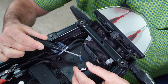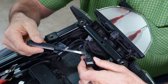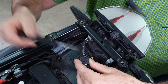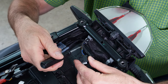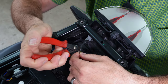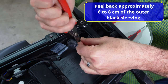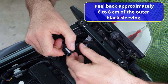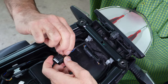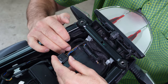Next, peel back the insulating sleeve on the socket that goes into the tail lamp assembly. Your sleeve may come further up to the edge of the socket. Carefully use a screwdriver to start unpeeling it, then use a pair of cutters very carefully to trim it back. Now we can clearly see the three wires going into the tail lamp from the wiring harness: brown, gray, and blue.